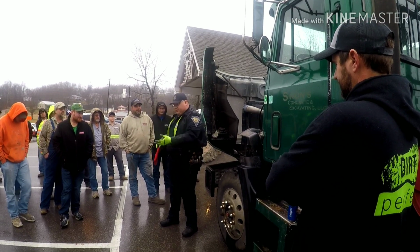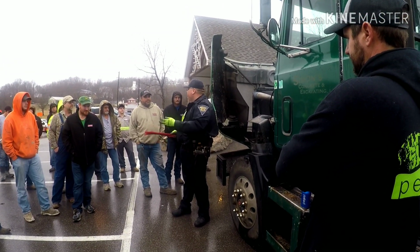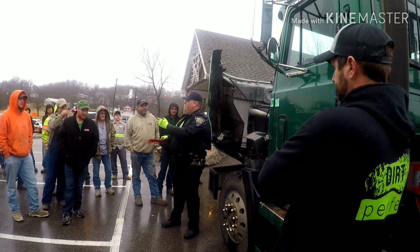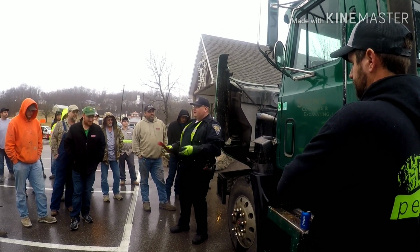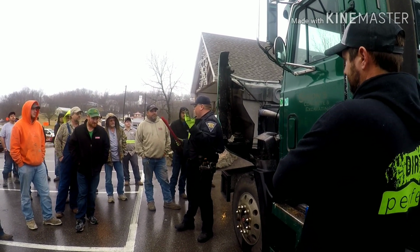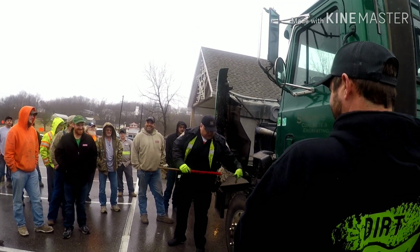When you're doing your pre-trip, walk around, stick your finger in there. It should come out dry, powdery. It's been raining, so maybe a little bit of flash rust, but we don't want severe rusting. We don't want any oil. We don't want stuff like that. And me as an inspector, I love it when I reach down in there, look, and you can tell like the brakes hadn't worked in 6 months. That's usually a pretty good find.